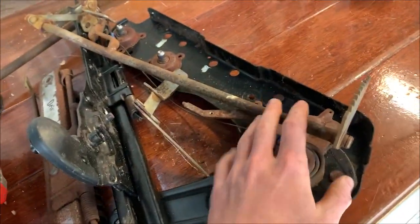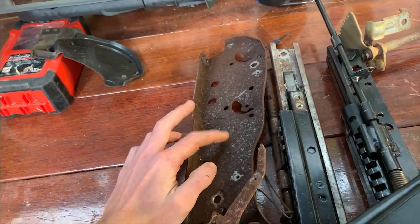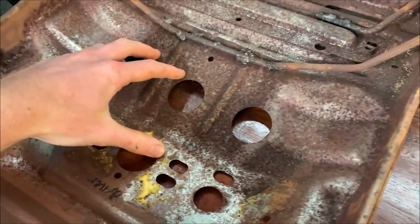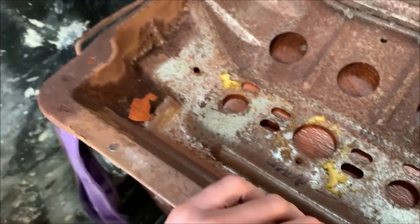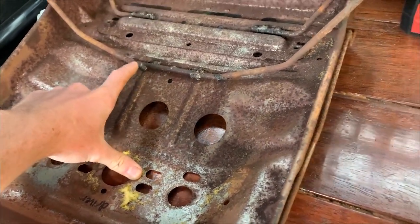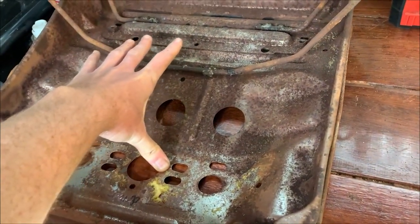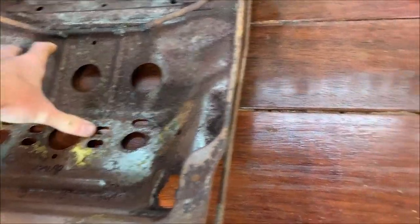The main parts, all the rusted stuff, it's pretty thick, heavy surface rust. However, they're all mechanically and structurally sound. This, on the other hand, the rust was a little bit too aggressive. So I'm fixing them, and I'm going to be laying etch primer, and I'm going to be laying a paint coat over both of these bucket seat things that take the foam.